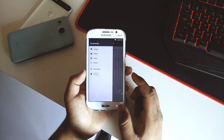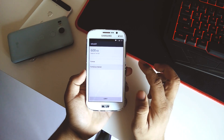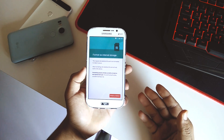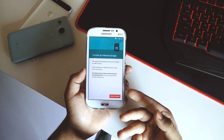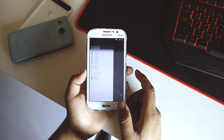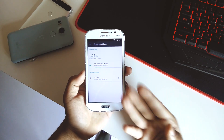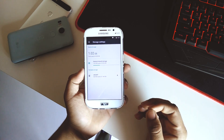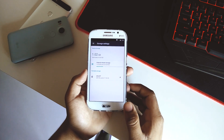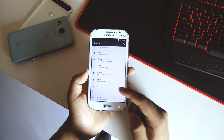In Storage we get SD card and internal storage. A good thing about this ROM is that we can select our SD card as internal storage — if you tap Storage Settings, you can see the Format as Internal option. All downloaded applications will go directly to the SD card which becomes your internal storage. The Grand has 4 GB internal and I have an 8 GB SD card, so that's 12 GB total. The downside is if you remove the SD card you'll have to reformat it to use it again.